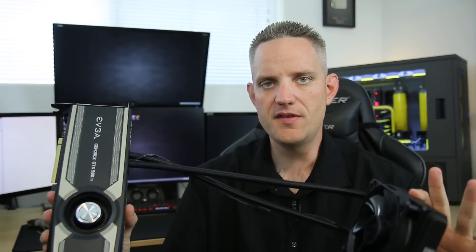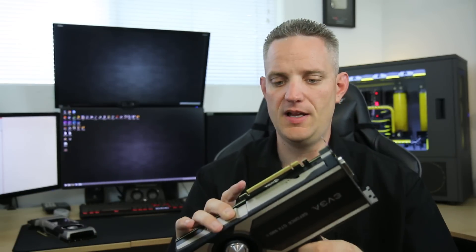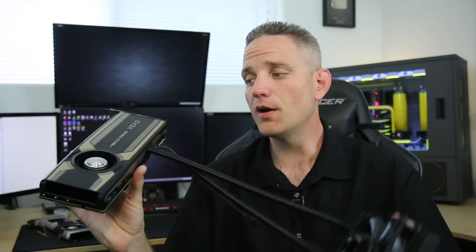All right. As you guys saw, max temperatures on this thing — 50 degrees Celsius with a single 120. What's funny about that is the Titan Xs in Skunk Works are actually getting about five degrees hotter than that in gaming, because it's all shared heat in a single loop with parallel and 560 and overclocked and overvolted and so on. But we were able to achieve 1,484 megahertz on this thing.